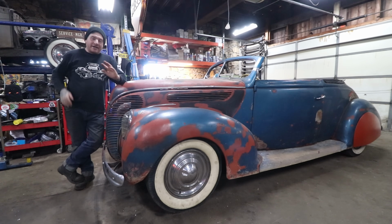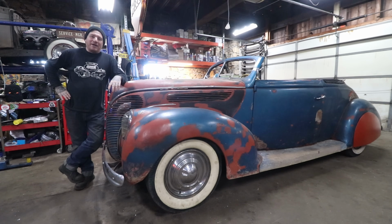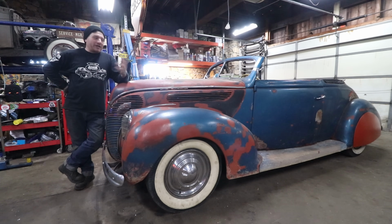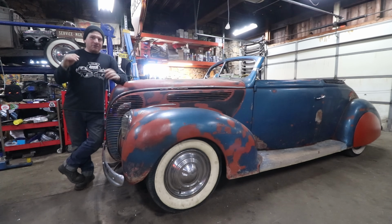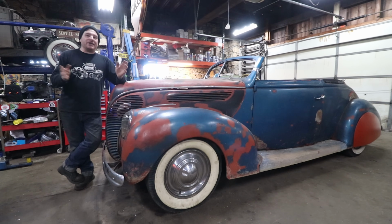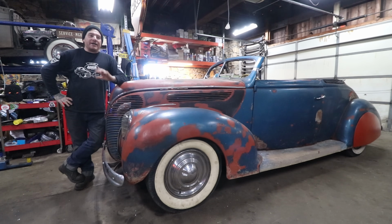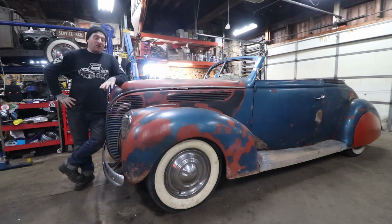So I kind of roughed it out using my hip, my knee, my arms to get it back to shape. But we're gonna have to pull the fender, and I'm gonna have to use a planishing hammer and dolly and whatever, and get that shape back where it's supposed to be. But for now, we got it. It fits, but I definitely want the skirt to go on a lot easier when the car is done, so that we're not having that kind of issue putting it back together.